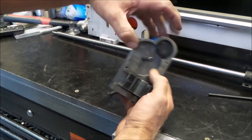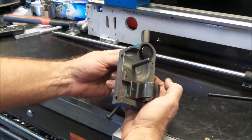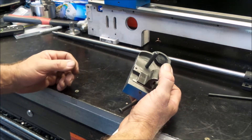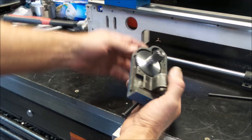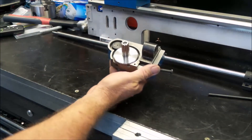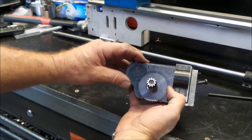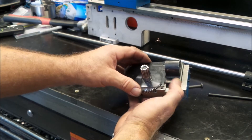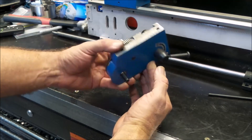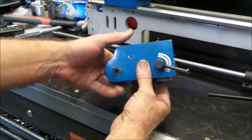The modifications to this carriage: a new bearing in the drive wheel, a slight modification of the bearing housing in the drive wheel because it was cut on a taper and was a little bit shallow — so now perfect, beautiful, engages nice and smooth with the driven wheel. The half nuts are now functioning very positively and correctly. And I've just finished making a gear cover — a dust cover for the gears here. When this is finished I'll grease it all up and this piece is pretty much done. Add that to the done list. Massive improvement on a simple piece like this.